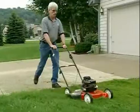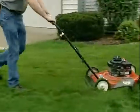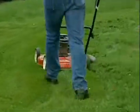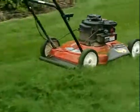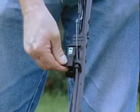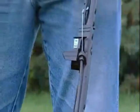As load is applied, more torque is required. Since excess torque is converted into speed, engine speed drops because the torque is needed elsewhere to do work. Changing engine speed, of course, changes blower housing airspeed, and the governor sensing device steps in to make adjustments.